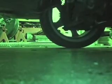And then once I go to the back, let me go to night vision again. I'm running the classic Walbro 255 with the Corvette regulator and filter. So let me see if we can see it. That little thing on the top, that's the Corvette reg. The nipple on the left side is the pressure side, so that goes straight towards your stock hard lines. The one in the center is your return, so that goes back to the return on your tank.